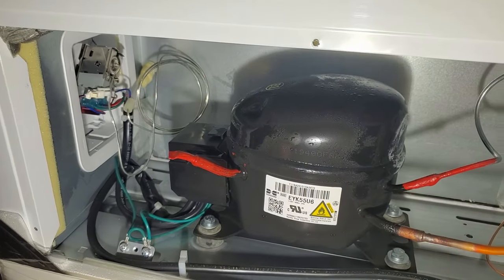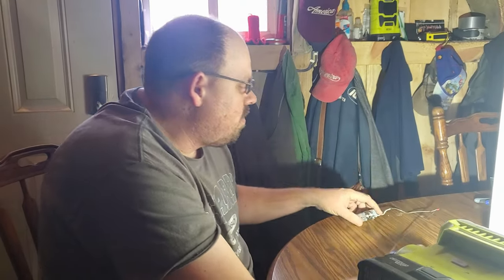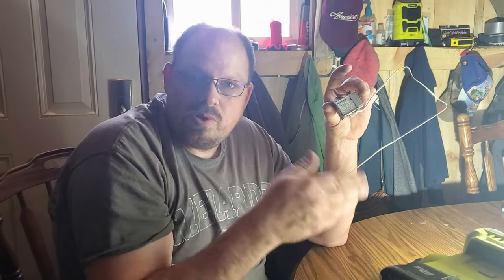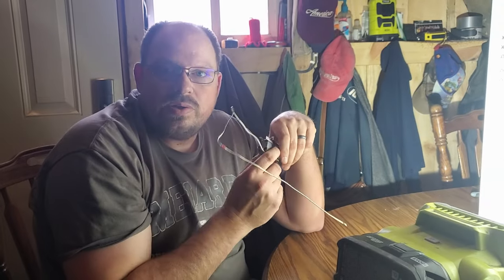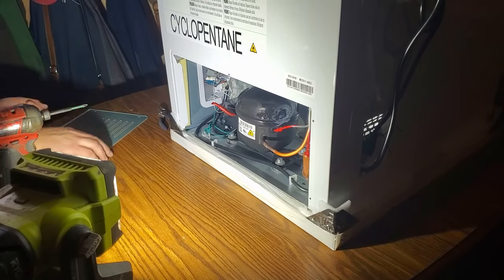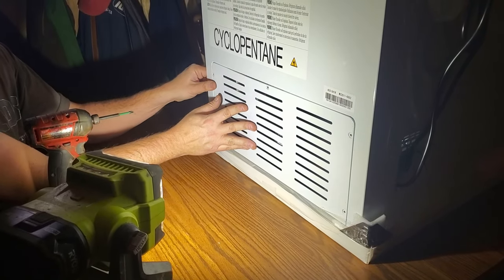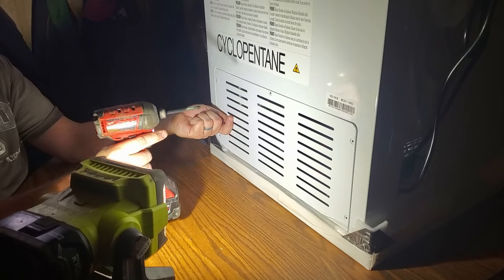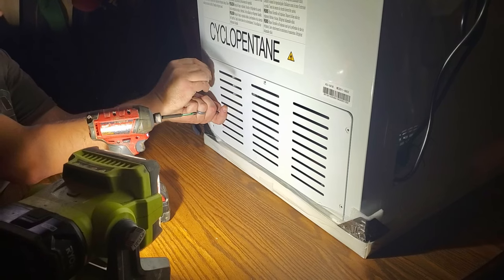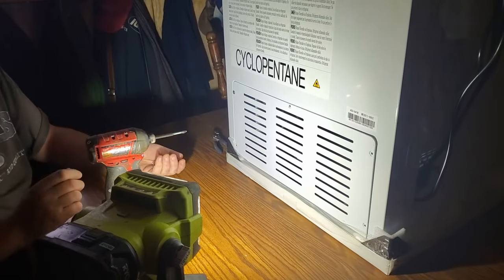Close her back up, and when we turn her on now it should work as a refrigerator with the new thermostat set to appropriate temperature settings above freezing. The old thermostat was a freezer thermostat set to below-freezing temperatures. I could save this — at any point I could turn this back to a deep freeze, or put it in something else, or use it if the one on our deep freeze broke. So this is something to hang on to. Whenever you use power tools on something small like this, be really careful — if you just overdo it with the screw gun you're going to strip out your screws really easily. Just go really slow and gentle, and when it gets there just stop.